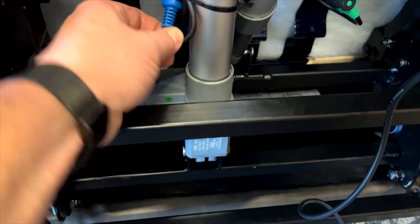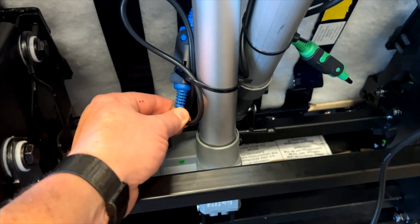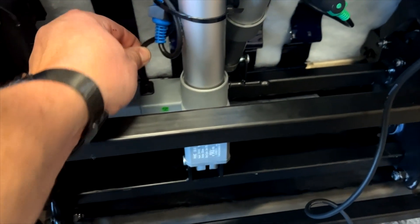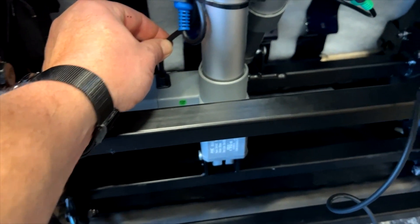The other diagnostics when troubleshooting an electrical failure: make sure you are wiggling in the area of connectors while pushing the hand wand to see if you can get it to function. You want to wiggle the wires that are going into the motors.